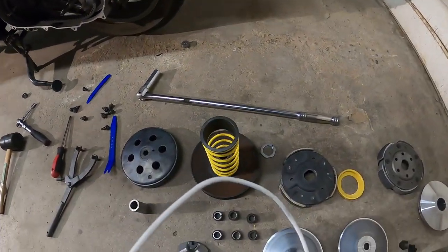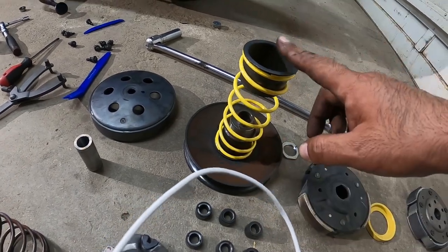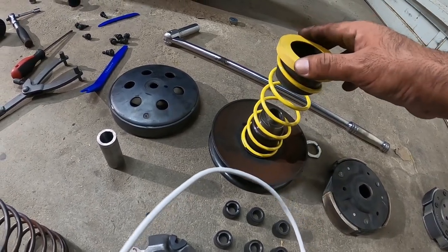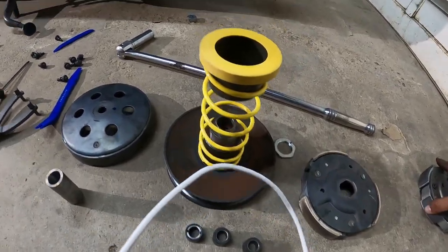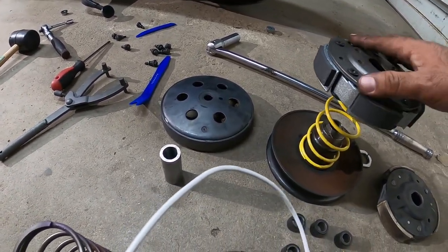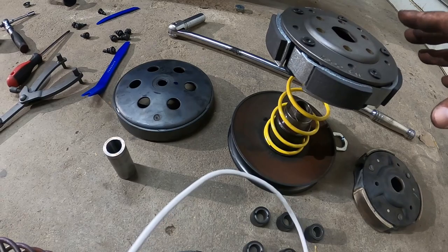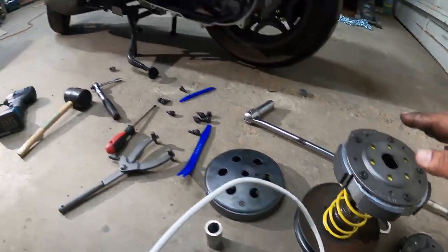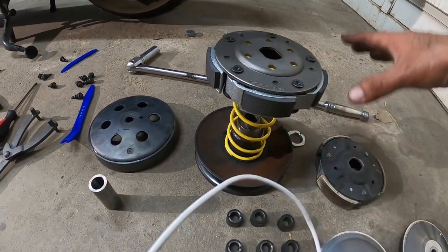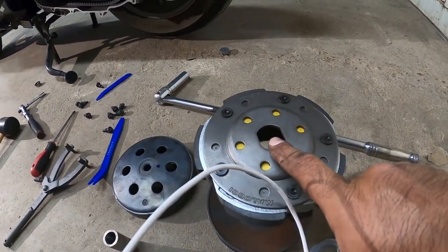All right. So next step is your clutch sandwich. So spring, you need the sleeve on top. The little sleeve perch here just makes it nice and snug so the clutch can sit on. And this goes in. Then you have to squish this all the way down by hand, or try to get it on a press like I have in my shop. We're going to squish it all the way down as slow as we can, and you've got to square it off, because this has a guide, you have to guide it into this hole.